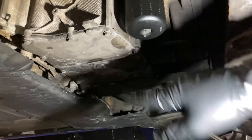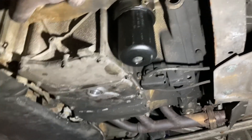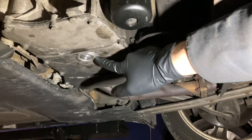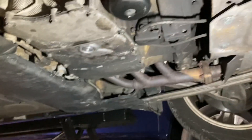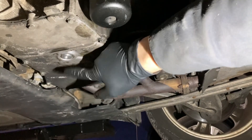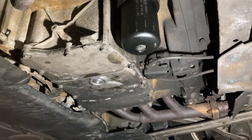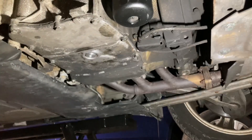When you start draining, you'll want at least 10 quarts of capacity. You want to kind of raise your drip pans up high because this is a pretty big hole relative to other cars — quite a lot of volume comes out and it tends to splash if it falls and hits a pan that's far away. So it doesn't hurt to have a helper; one of you can loosen this while the other holds the pan close by. I would recommend draining most of it from the pan before opening the oil filter housing.